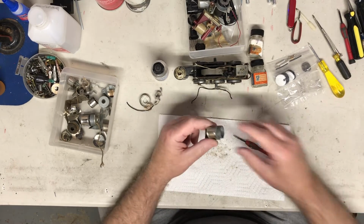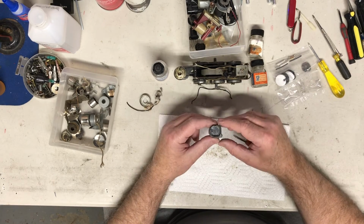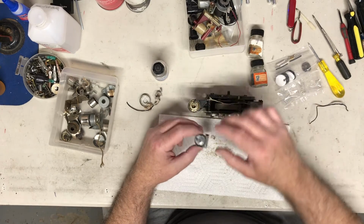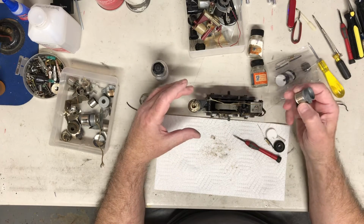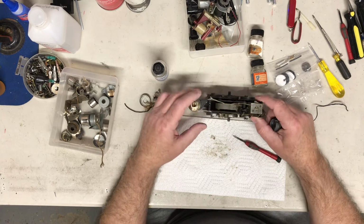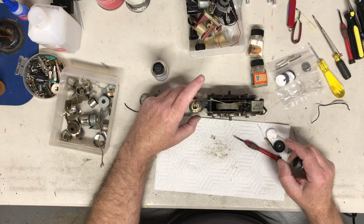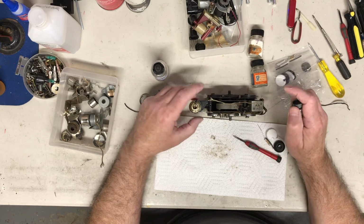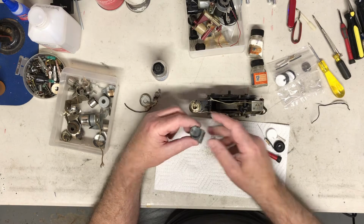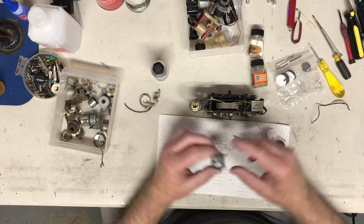So I'm doing it this way just to show you that these are different on different motors, as I said. You can do this without taking it all apart. If you take your body off of the motor, take the shell off, get to this part where it's connected, they all seem to connect differently. Some are screwed down to the frame. Take it loose, pick it up where you can work it in your hand. If not, you can pry it off like I did while it's mounted. It's more difficult because you need more hands, but you can do it while it's in place.